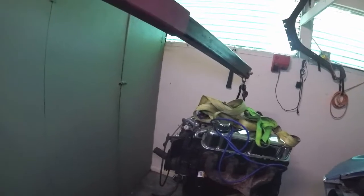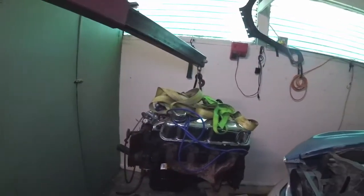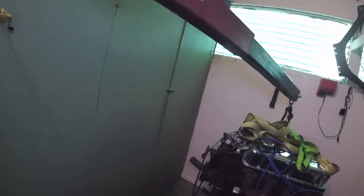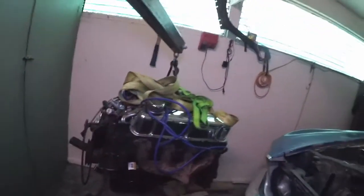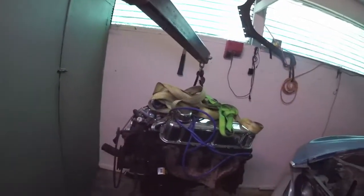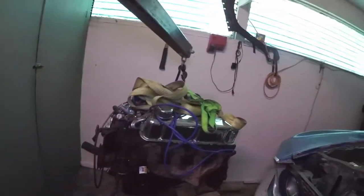I'm also probably going to do an oil pan gasket and a rear main while I have it out, since it'll be easy to do. And then when I go to do modification, then I might end up just leaving the engine in the car, since it'll most likely be a top end type of deal, and that'll be easily done inside the vehicle.